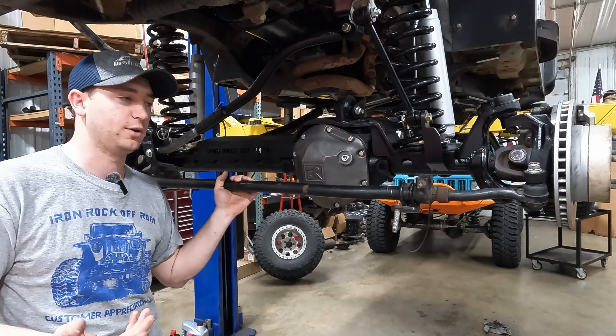Tie rod is installed and both castle nuts are on — tight but not yet torqued. The bar has a bend in it for flex, but you want this bar level. Push down your tie rod heim joints so they're resting on the bottom while the bar is level, then tighten your pinch bolts. The heim joints will move a little — that's by design — but you want them bottomed out with the bend going forward before clamping. Position the clamp as far toward the outside while making full contact with the powder-coated bar.